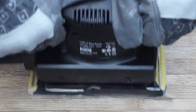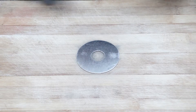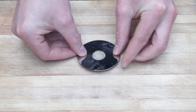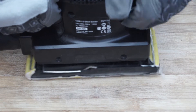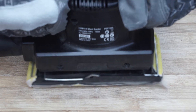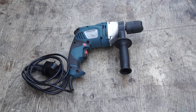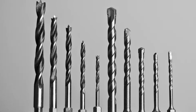We now check the platter to make sure that the sander has left abrasions evenly over its surface. The platter should change from bright and reflective to a dull matte texture. If in doubt which side of the platter the data was stored on, flip the platter over and do both sides just to be sure. Sanding will probably have made the drive unrecoverable, but we have plenty more in store for this drive. The next stage of our destruction will use a drill to scour holes in the platter, removing large amounts of its matter and making it effectively unreadable. This is a potentially dangerous operation, so please don't try this at home.